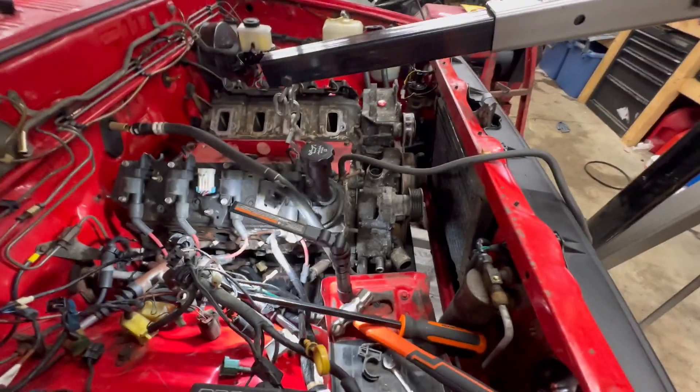I've got a new set of motor mounts here. A lot of people say these might bust off, which is possible, but I want to try it. They're motor mounts — I imagine they'd have high-rated bolts even for the 2.2. There's a torque factor but it should do the job. The plan is to design a mount that bolts onto the LS four mount points and then comes down with full contact on that pad — about three and a half inches by 1.75. If we could do that, this would be a really easy fab-to-sell kit for dropping an LS in a B2200, without having to cut all these mounts out and fab and weld them back in.